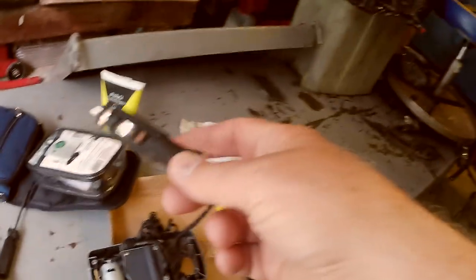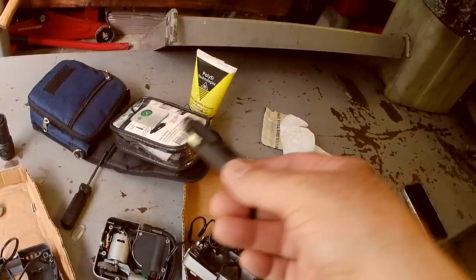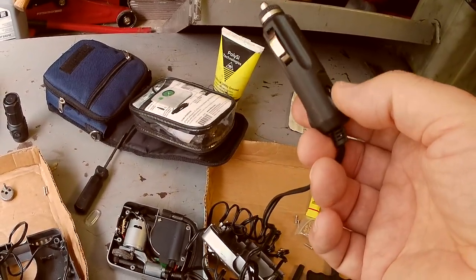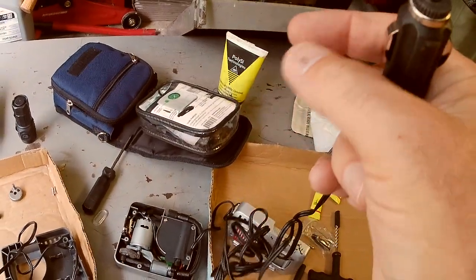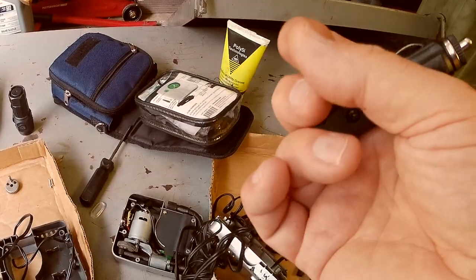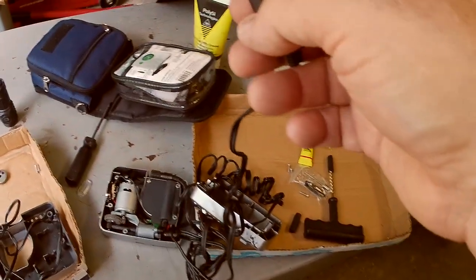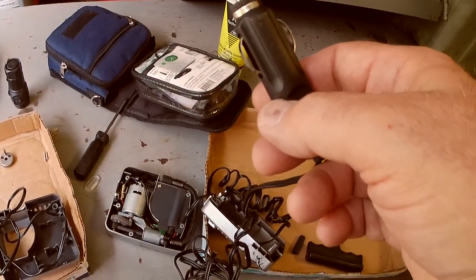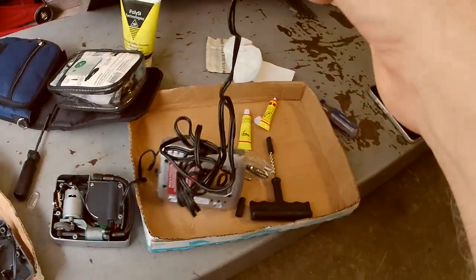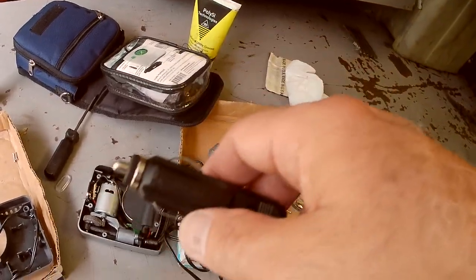Such as there's another style pump I have that has a fuse inside this plug that plugs into your accessory outlet. Those fuses are not making a good contact in their little U-shaped connection. They just snap in and they don't have much spring tension, and that blows the fuse because that's a point of high resistance. It's not flowing through that loose connection, and it blows the fuse. So I would suggest covering that fuse with aluminum foil and then put it back in.